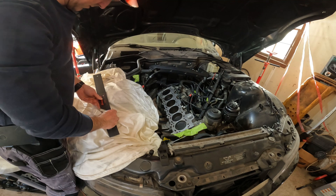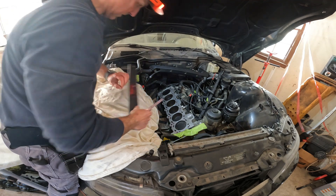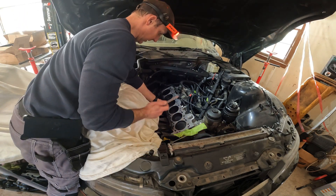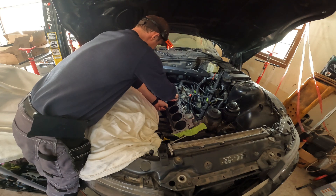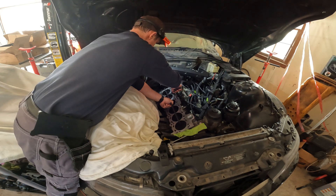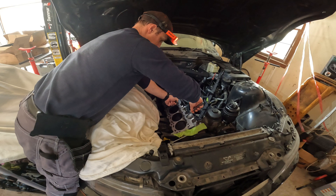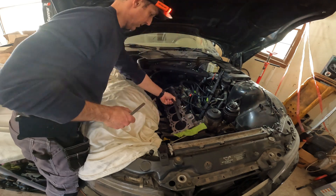And then we need to switch to the 0.1 and check your longitudinal, which is straight. You just take your feeler gauge and check all these points to make sure that you can't slide it under. Block is viable. The head is ready to go, the block is checked. Next step is putting the head gasket on and getting the head on. Super excited to get this thing running this year. Thanks for watching — please like and subscribe.